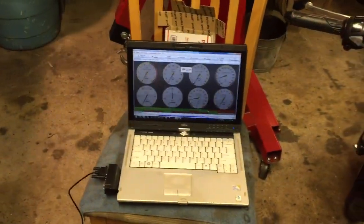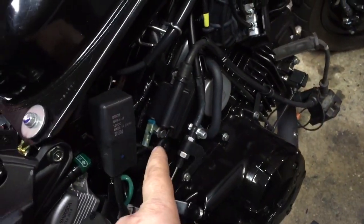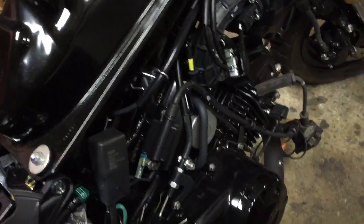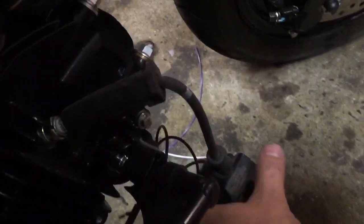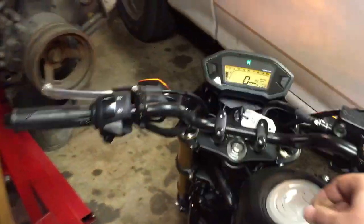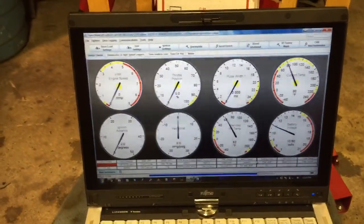I totally guessed on the trigger angles and some ignition stuff. I did a lot of reading and asked on Megasquirt forums because the CD ignitions create a lot of noise — so it's not connected at all. What it's running off of is an LS coil, like a 5-3 coil pack. The ground for the coil pack is just stuffed into the head because it's all temporary wire nuts, but I can't believe it's running already. Factory sensors, no modifications — into a Micro Squirt.